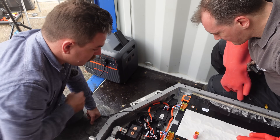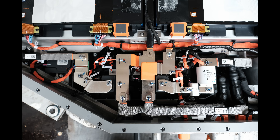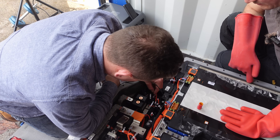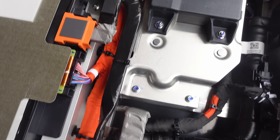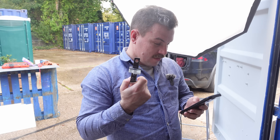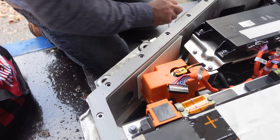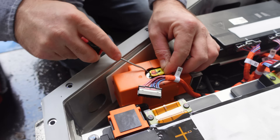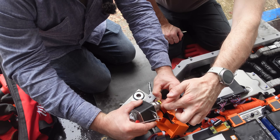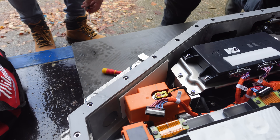The shunt has one, two, three, four, five, six cables feeding into the main loom back to the control unit. The theme of this battery pack is modularity — we see a pressure sensor from Honeywell, a current sensing unit with CATL markings, contactors which are off-the-shelf products, and then we see this pyrofuse, which we haven't talked about yet. We could take it out now because it's really the only bit wanted for another battery pack, but we don't want to damage it.